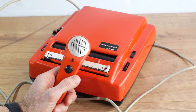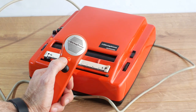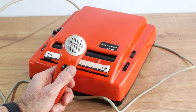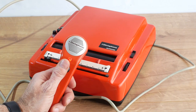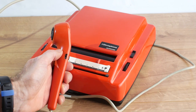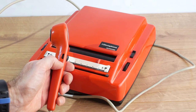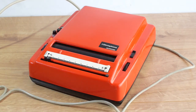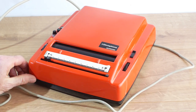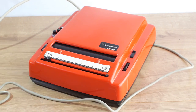Powering up, an orange neon glows and this switch starts or stops playback. Pushing it upwards makes a light glow showing it's ready to record; pulling it down exits record mode. There's a switch on the side in D for Dictation - moving to C for conference mode increases microphone sensitivity. There's also a small tracking adjustment lever for the play head, but you should mostly be able to leave that alone.